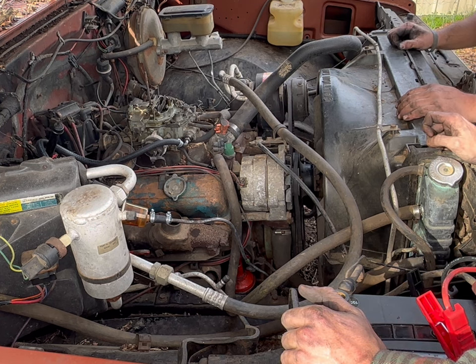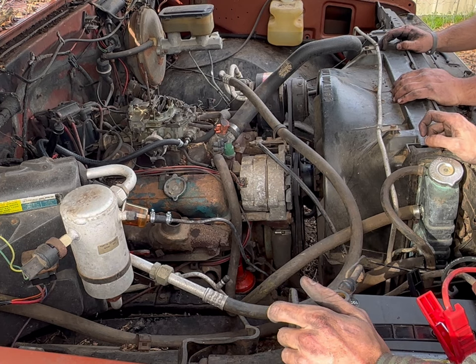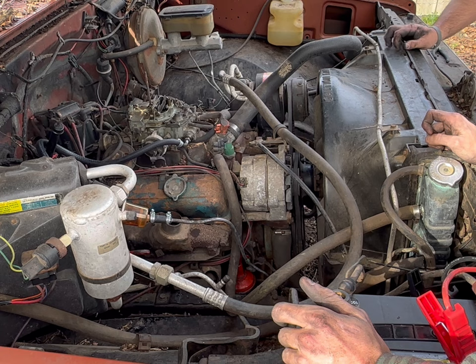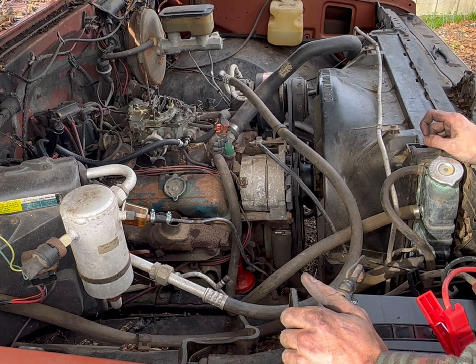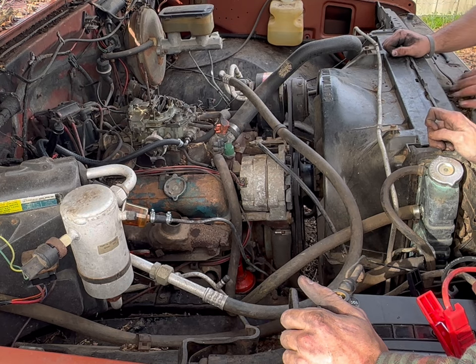Kids are so bipolar, dude. So is the alternator not charging? I don't know. You get the voltage meter? Well, go ahead. Can we get it running long enough to even... I mean, it should pop off more than 12 volts. It should be, you know, 13, 14 volts. I know. You got to get it run for more than 2 seconds.